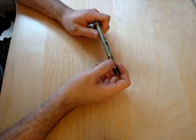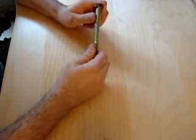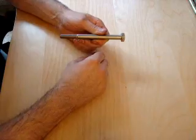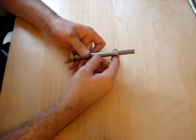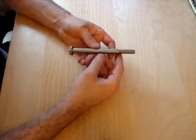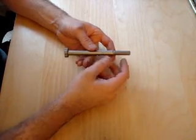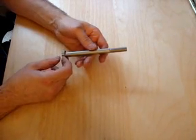So, if you're going to be doing this replacement on an automatic transmission car, definitely get TAB tabs. TAB is an acronym for trailing arm bolt. This is hands down the strongest bolt you can buy for the DeLorean. It's been said countless times, if you want the strongest tabs, get TAB tabs. And if you have an automatic transmission car, I would definitely recommend it because you don't want to ever do this process again, or at least not often, because it's not an easy process.